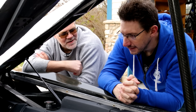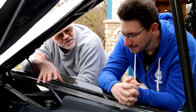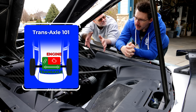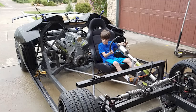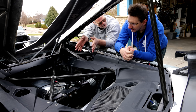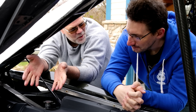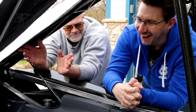What's your transmission? It's actually from a Porsche 911 — and it's not actually a transmission, it's a transaxle. It's a transmission that actually has a differential in it, all one package. The wheels are at the front of the transaxle, and that's actually where the differential is. There's a thing called an LS swap that people do with their 911 Porsches — a company makes a mating kit for these two parts. The community helped us with that; one of the guys said, just go to Kennedy Engineering and get the interface kit and it's all good.